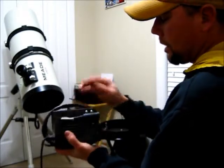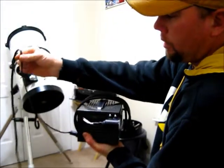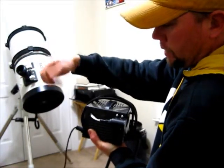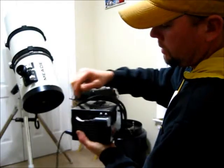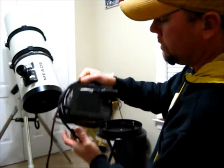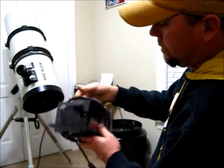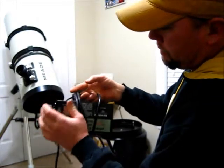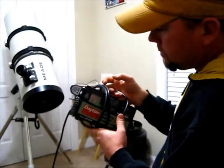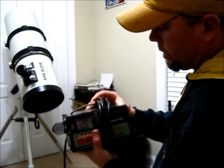And inside, the only thing I really did was I just took the 2 wires, which are just slip connectors on the inside. One goes to the amp gauge, the other one goes to the outlet power, or whatever you want to call it, the piece in there. Just slid those off, cut the wire, spliced in the cigarette lighter adapter, and just plugged it back in. And that was really the only thing that had to be done there.